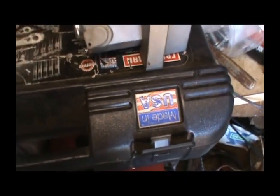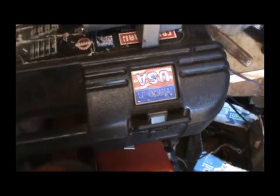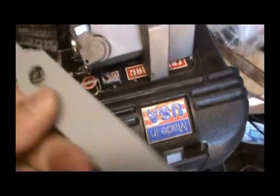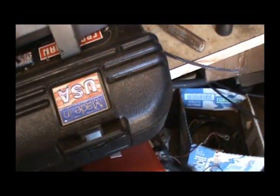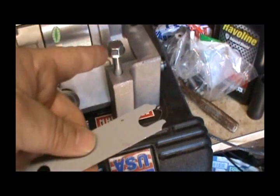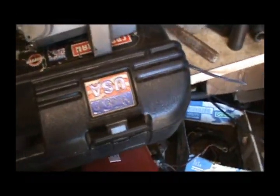You're supposed to replace your starter bolts anytime you change out the starter. Unfortunately I haven't had the extra bolts, which might be the reason I've been having issues. It also came with a shim, but it's a straight shim — you can still use it, you just have to go sideways. But I've got some offset shims if I need them and I'll use those.